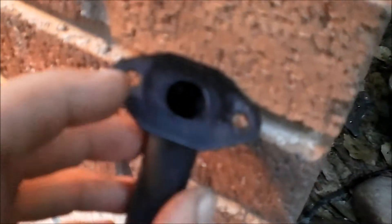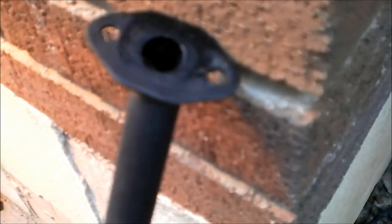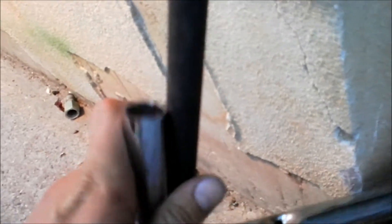If you look really closely here you can actually see the shape of the port — it's definitely trying really hard to get that exhaust out but just can't do it. Now most people could just port this a little bit bigger because there's room on either side. Up and down not so much, because that's about perfect, but side to side you can open it up a little more. What I'll be doing is chopping this pipe off and putting this larger chromed pipe on — it's thick enough to weld.